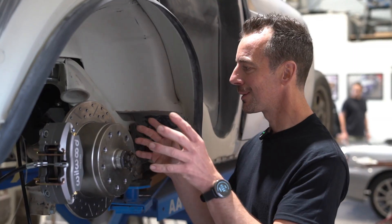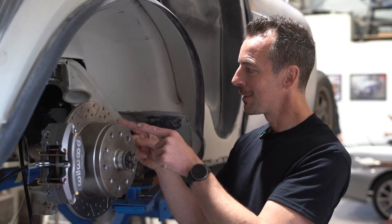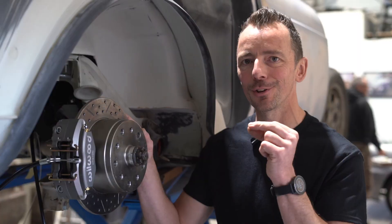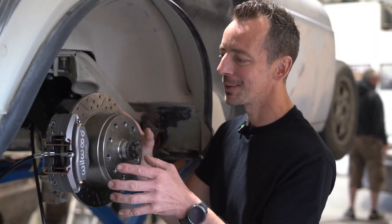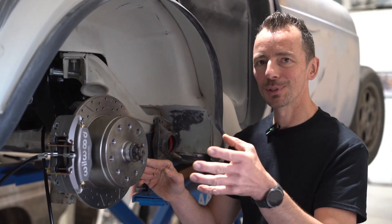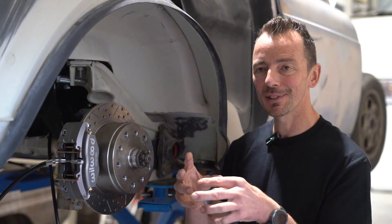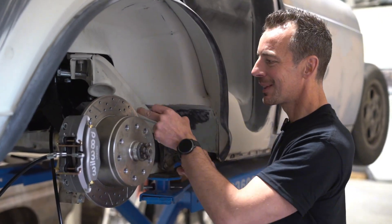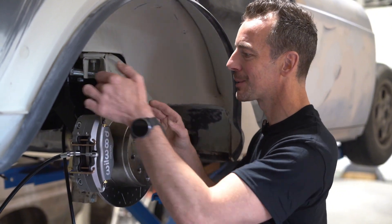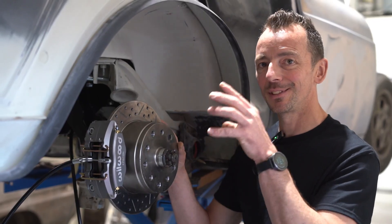The last pipe on the Variant — and this is the brake pipe from the body to the swing arm — always has to be a flexible hose, which we're going to do braided stainless steel. Then along this arm from that mount to the caliper it's going to be hard aluminium with dash-3 fittings. It would have been way easier to do copper throughout, but it doesn't look show car. So we've had to find adapters to go from dash-3 to the fittings in the calipers, and also adapters to go from dash-3 to the M10 fitting on the flexible line. Finding those flare sizes and thread sizes takes time — it's easy when you know how. These lines are going to look trick: super straight, nice tight 90-degree bends where we need them, everything nice and parallel — real show car.